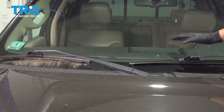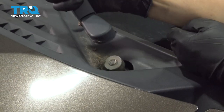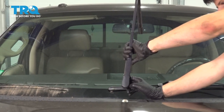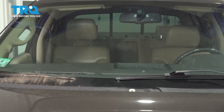I want to remove the wiper arms for this particular vehicle. You want to flip these up. There's a little tab on the back side, which I'll show you in a second, and it just comes off like that. Once you pry this tab away, you should just be able to pull it off of the wiper transmission. You want to do that to both sides.